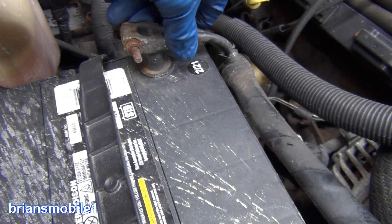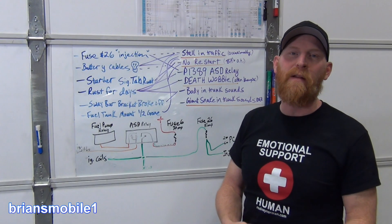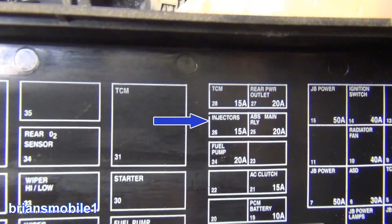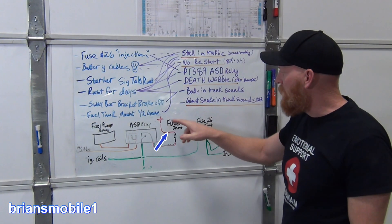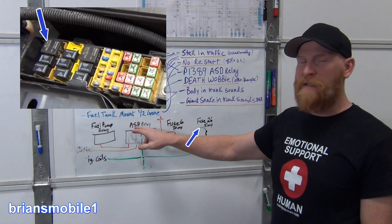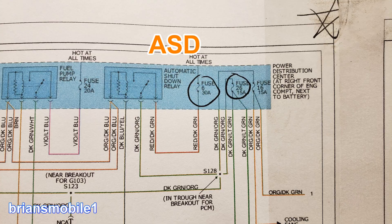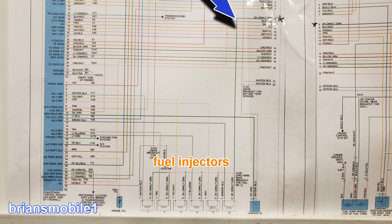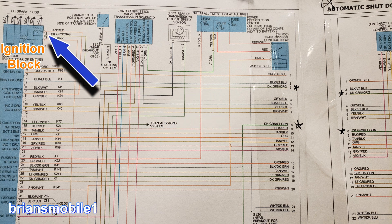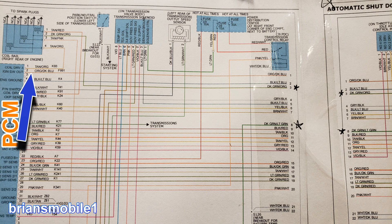You're not spiking, you're not intermittent, you're not doing weird signal stuff that can mess up the electronics. We're diagnosing in this video why Fuse 26 is blowing. Fuse 26 gets its power from the 30-amp slow blow fuse via the ASD — or auto shut down — relay, which is responsible for turning on or turning off fuel injection signal and spark signal dependent on crankshaft signal. So it's tied into the computer every which way.